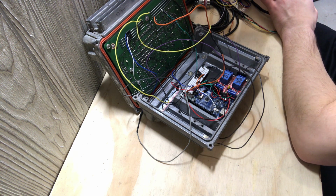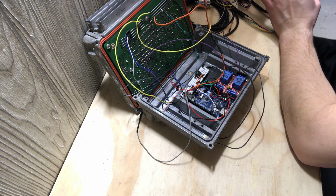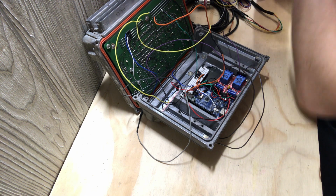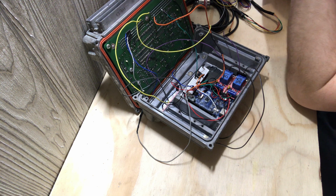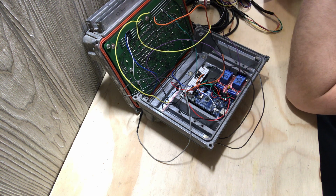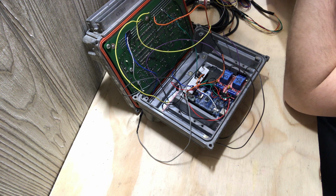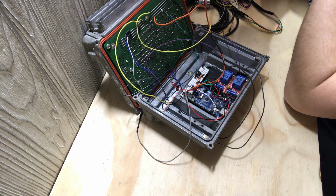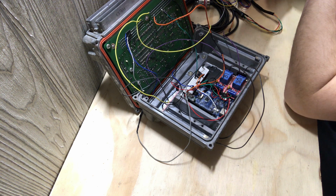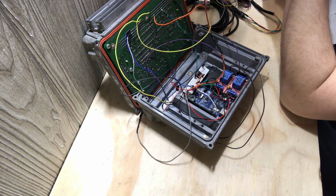That way, if you have this set up, and I'm thinking in terms of another builder or user that's going to have one of these, and they want to take it to a dyno after they build their car, and their dyno guy or their tuner might use EFI Live or HP Tuners or whatever they use to tune the car, it won't affect what is happening inside of this with an Arduino. All I want the Arduino to do is read the information of what the PCM is doing and then make changes to the outgoing items on the PCM itself. It's not actually manipulating the PCM board or anything, but using the unused pins or using the used pins, depending on what it's going out to the device controlling the engine.